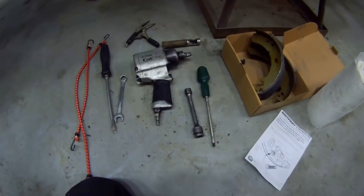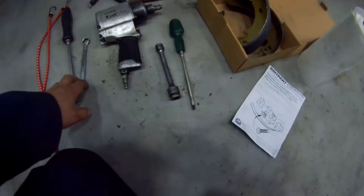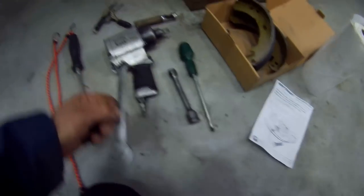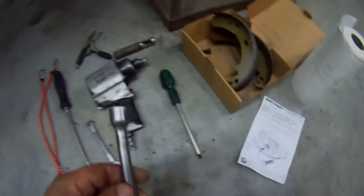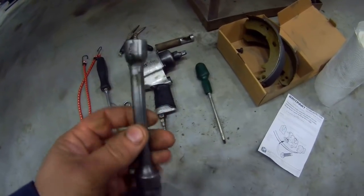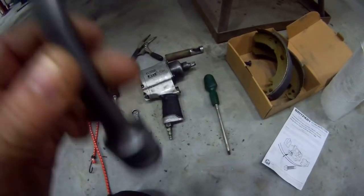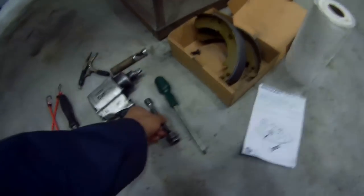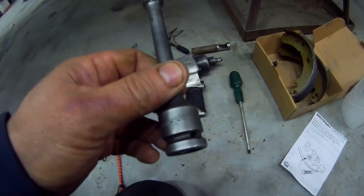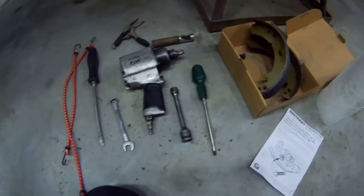So here's the tools and equipment that we're going to be using. The nuts on the prop shaft are 9/16th AF. So I have a small combination spanner and this little tool, which is as good as gold — this is one of the tools you really should have. You can see how polished it is from how much I've used it. It's a very thin wall socket to go inside the universal joint, and it is so quick to use. Use that in combination with your air gun and it spins them off. They come in three-eighths, so you could use a three-eighths gun, which is a lot better than using that great big heavy thing.